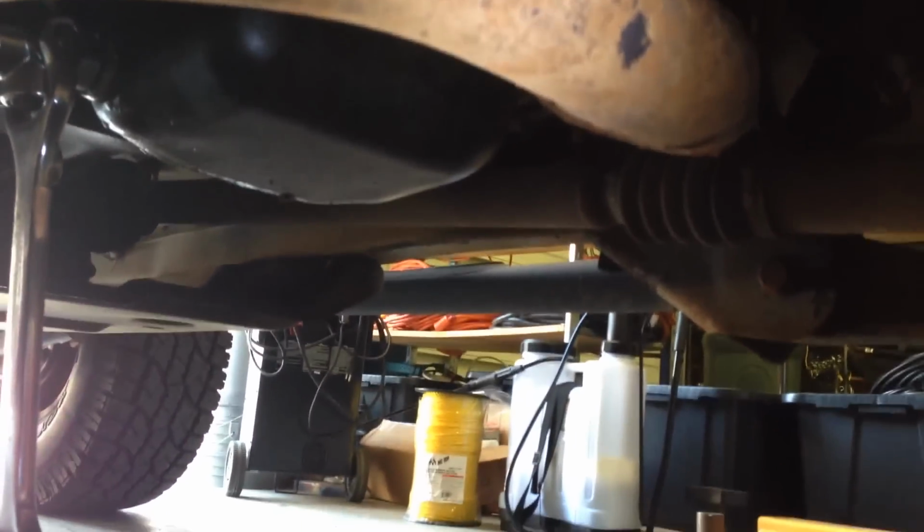But over here on the front, you can go ahead and drain your radiator too. You can kind of see on this one, move this thing out of the way. Right here is actually going to be what you unscrew to drain your radiator. Drain it out, and then you can also follow this hose right here, and it goes up to here. If you disconnect that from the engine, it'll drain a lot of the antifreeze out, make the engine weigh a whole lot less. But go ahead and drain the oil, get that antifreeze out, help you out a lot.